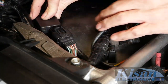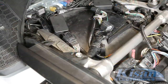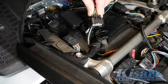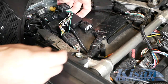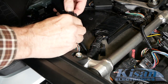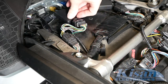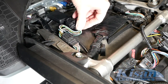For the purpose of demonstration, let's assume you do have another harness installed — such as one from Pathfinder, Ciro, or in my case a Show Chrome isolator. Kisan expects that these will all work with the Tailblazer. You just want to make sure the Tailblazer is the last thing in the series. I'm including my Show Chrome harness here just so you can see how I do it. Make sure all of these harnesses lay down flat and out of the way so that your seat goes back on properly.